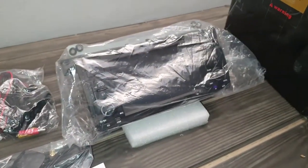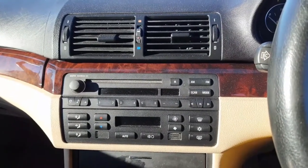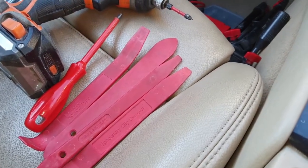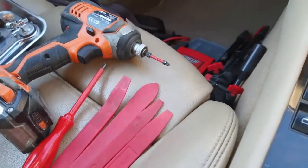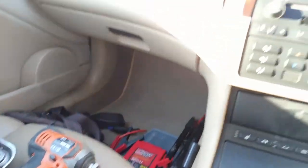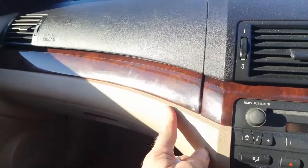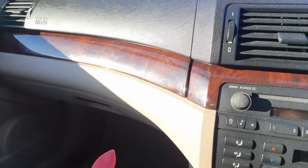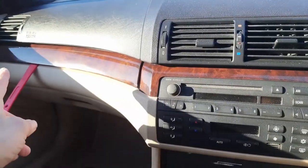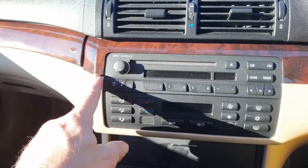So we're inside the car now. I've got my tools ready — you don't really need a great deal. I've got a selection of plastic levers to get the trim off and an impact driver, but all you really need is a Phillips screwdriver. I'm going to start by removing the trim, going around the side here. Remove this trim and the second part, which should expose two Phillips screws, one each side.